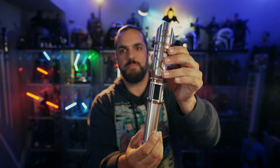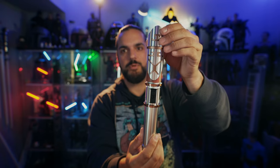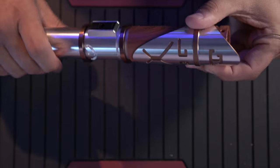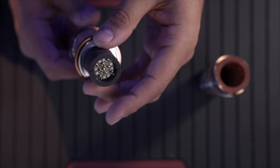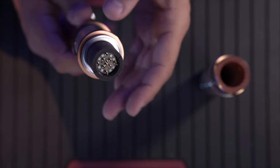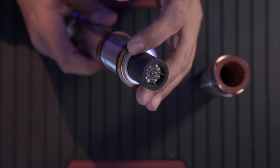So like these buttons do have to come lined up with the front. So they would be clocked like that. I actually found that using 3 timing shims worked out perfect. So we're just gonna put it over there, throw that over the threads right on top of the metal copper ring there.